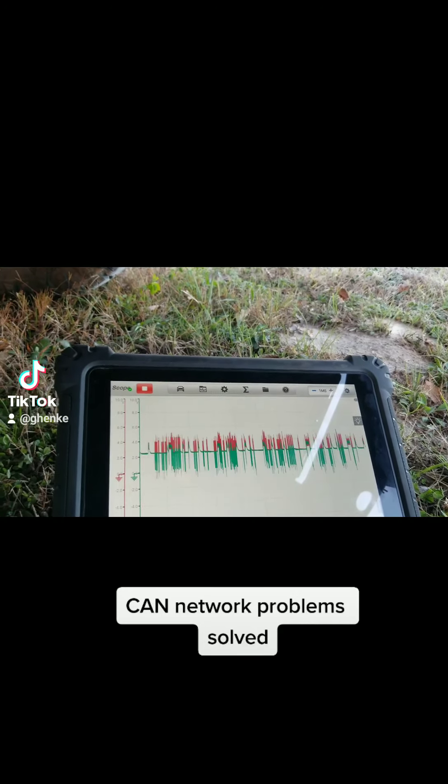This terminating resistor is wired after the trailer brake control module. We'll go ahead and test this — this resistor is good, 121.2 ohms. It's cold out here, and the customer's complaint was that it won't start when it's cold outside. These terminating resistors are good and the network only reads 120 ohms — the wiring is never getting to this. Something's wrong with the CAN communication or the controller that it runs through to get to this. We'll look at a wiring diagram.